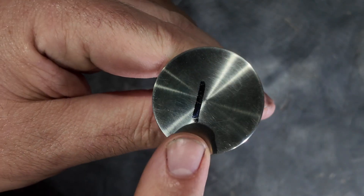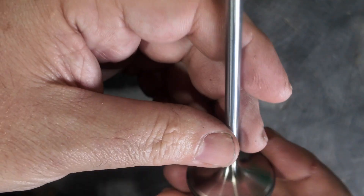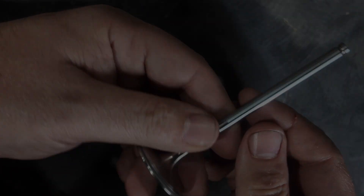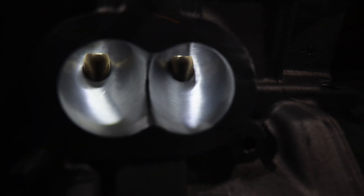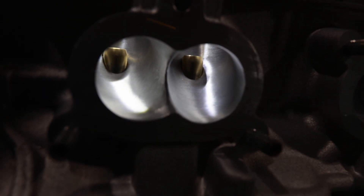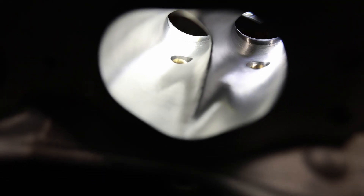This is how you make all the power without dealing with all the hassle. We made it flat-faced for strength. Sometimes when you start running a lot of boost, the valve will start pulling through or concaving. So especially because it's a small stem, I made it flat-faced. It's actually a very lightweight valve still, but it is much stronger than OEM. That's going to do it for us today. Be sure to like, subscribe, comment below - I'd love to hear from you. Toodles. Head Games!